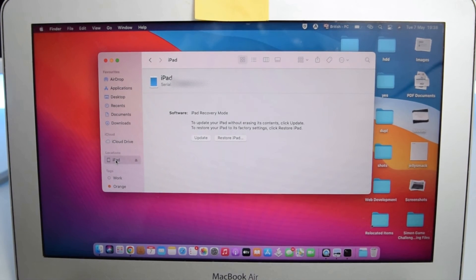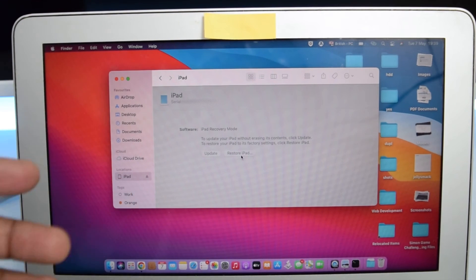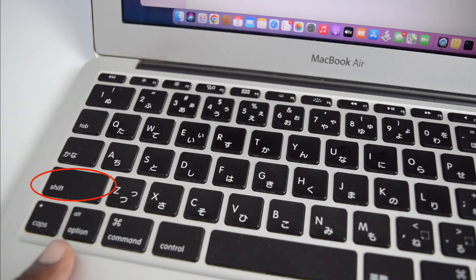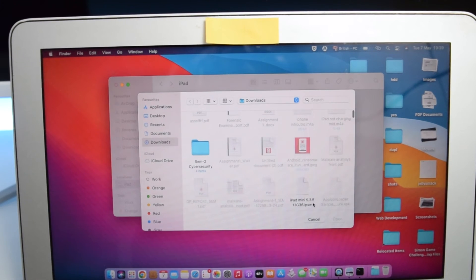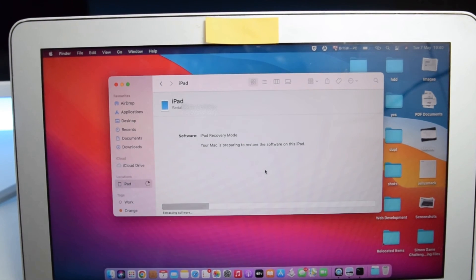If you don't see your iPad showing up, make sure you try changing your USB cable — some cables in the market only charge and do not transfer data, so make sure you have a data-transfer cable. Once we're here, the next thing is to tap Restore iPad. But first, if you've got a MacBook, press and hold the Option key while clicking Restore iPad so a file picker window pops up. On Windows PC, press and hold the Shift key instead. Then locate the downloaded IPSW file — in my case, iPad mini 9.3.5 — select it and tap Open. It will ask you to confirm erasing and restoring your iPad; simply tap Restore and the installation process will begin.